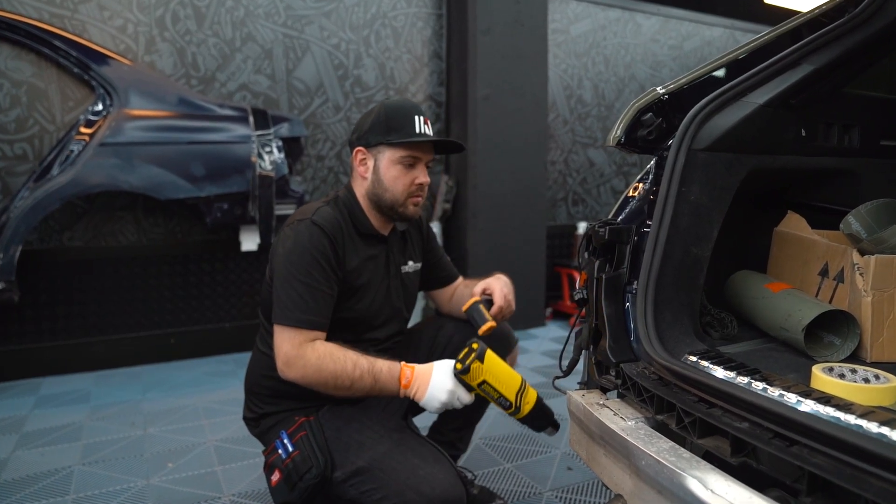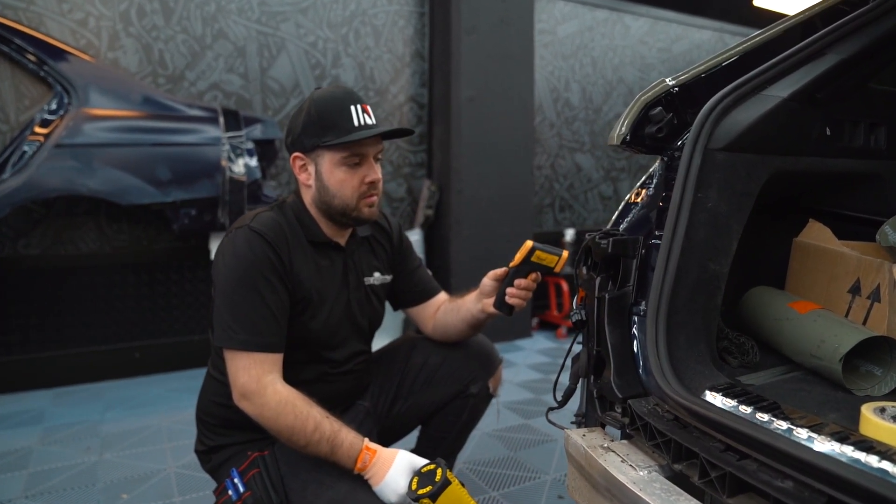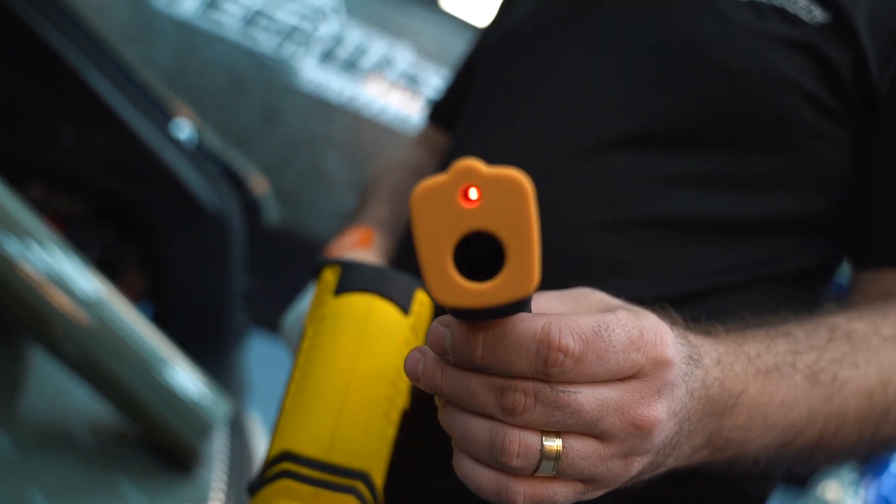Once we've finished laying down the panel and done the cutting, this next step is very important: we do the post-heating of all the edges to over 100 degrees. Get yourself an infrared thermometer and check it. Now we've completed the rear fender — you can take your time to check that the rubbers go a little bit over the edge so you can hide all the original paint color underneath.